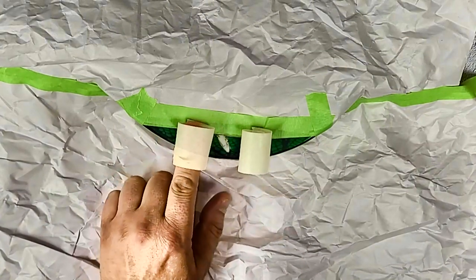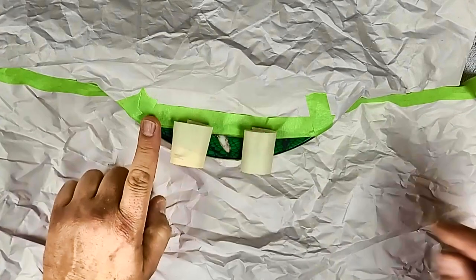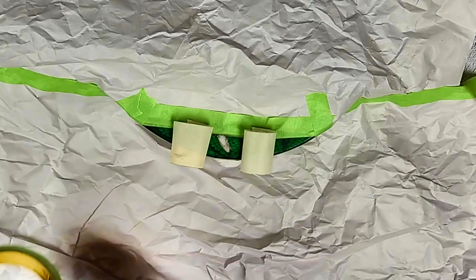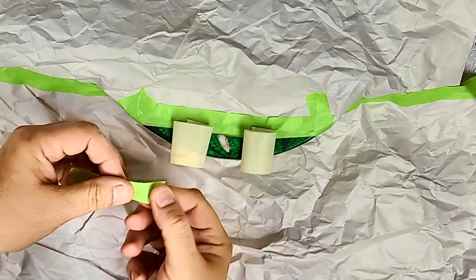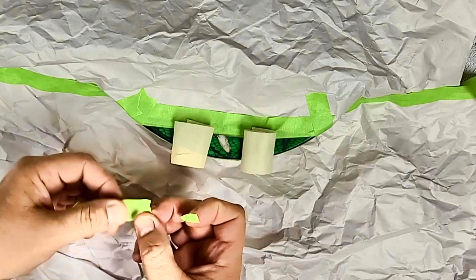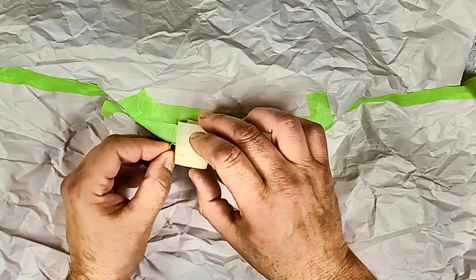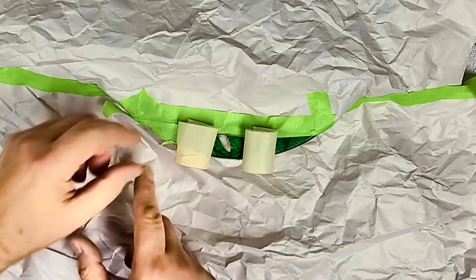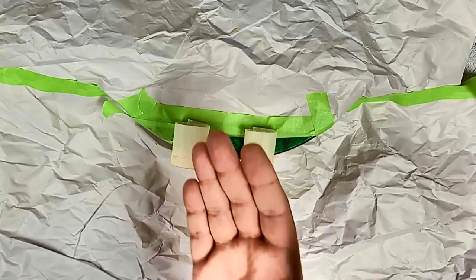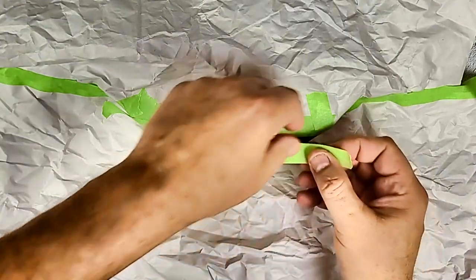I want it wider than the damaged area. Now I need to cover these two sides here, so I'll get my regular masking tape and just butt it up against underneath here. I'll cut that a little straighter — get that as close as I can to cover that area. I'll use this little piece to cover this spot right here. I'm rolling this back a little bit, making sure it's still rounded and tucked under. The reason for that is when I dust paint over here, I'm not going to have a real hard tape line.